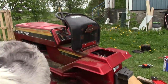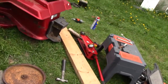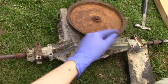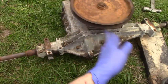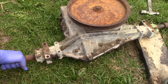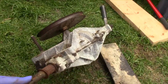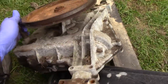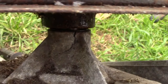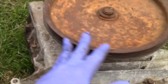It's got a blown head gasket and pretty much everything's wrong with it, but most prominently there's a bit of an issue with a rear axle — you can see the input shaft spins but the wheels do not. The differential part seems to be working but no matter what gear you put this thing in it won't really do anything. If we have a look in here, you can see that there's a very large crack right there, and if you put this thing upside down there's fluid coming out of that crack. So something's gone horribly wrong with this thing.